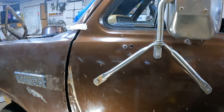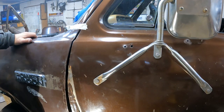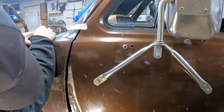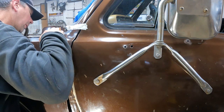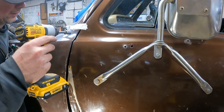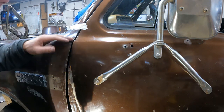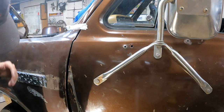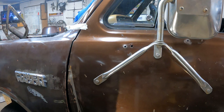I'm putting just a little bit into it with the floor jack. It looks like it picked way up — that opened up the gap on the bottom. The whole gap is now about the same. I need to back it down to about there. That's about where my bolt showed. Let me run it right there. That is just a touch high — I've got three shims in, probably only needs two. That really straightened it out quite a bit. The fender is in just a hair.